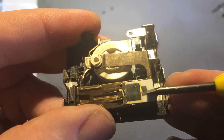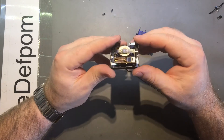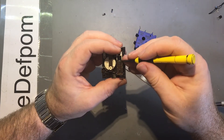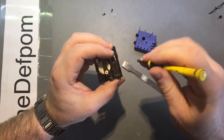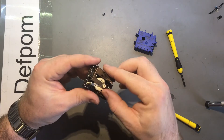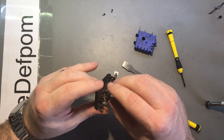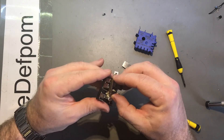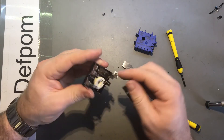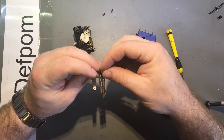I'm getting light — see it's been sitting there instead of over here, by the looks of it. So maybe that's been the issue with that. I might try reassembling it and keep it as a spare, because it may actually work once I've done that. It's only $20 so it's more of a curiosity. Let's pop this piece back in — it all sort of hooks in and springs in here. That hooks underneath just there, then under there and pops in like that. That's what holds it together. You can see the bimetallic strip here — it looks fine, doesn't look cracked or anything.